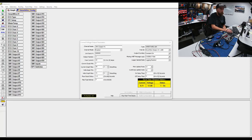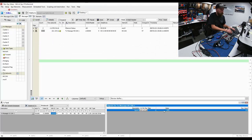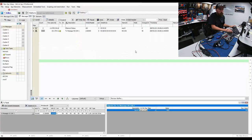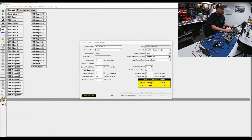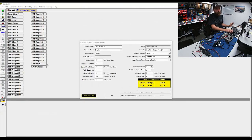Okay. So let's try this again. First we'll make sure that the hardware is off, so we'll send 160. Validate that the hardware is off. Perfect. Now we will send our command value of 191. That should enable the output status to on, and then we will check the off status by going to 170, and now the hardware is off. So everything is being interpreted correctly.